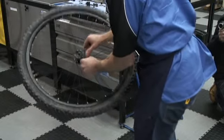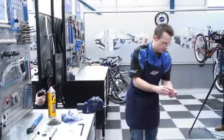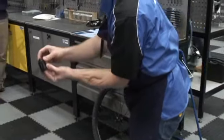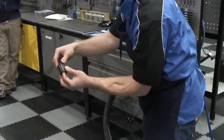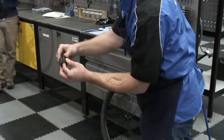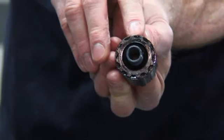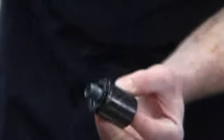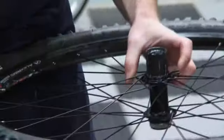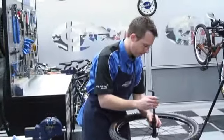Quick look at the threads inside — yes, that's fine. We've got a very fine coating of grease on the free hub body bolt. We can slot that through. There's a little bit of oil on the bottom of the ratchets — this is what makes the click of the hub, and sometimes it can sound quite crunchy, so it's a good idea to give it a little clean and pop a bit of fine oil on there. That should keep it running nicely. You can feel it locate into the splines, and we can use a 10 millimetre Allen key to do up the free hub body bolt.